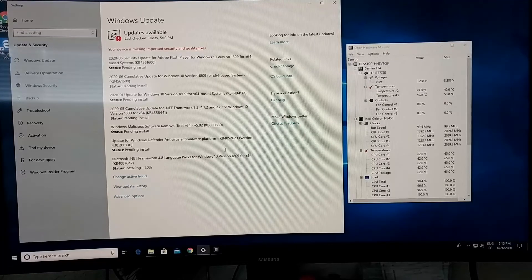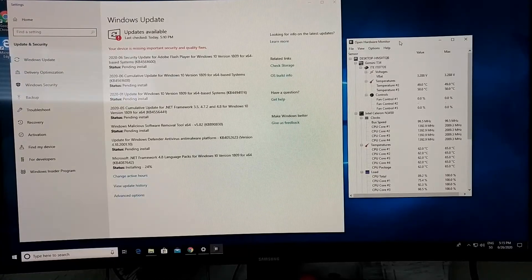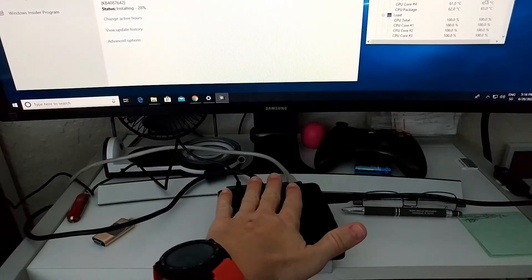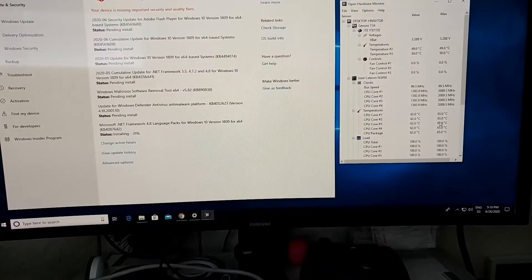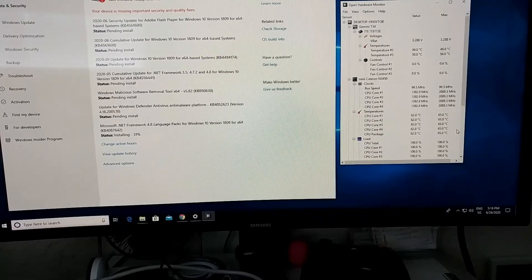If it looks like nothing is happening but updates aren't complete, a reboot is a good idea — though I'd avoid rebooting while it says 'currently installing'. Running Open Hardware Monitor showed CPU load near 100% from the updater, but CPU temperature was only 65 degrees Celsius, which is quite healthy. The surface of the PC was around 45 degrees Celsius (115°F) — very hot to the touch, but internally the 65°C CPU temperature is well within a safe range.